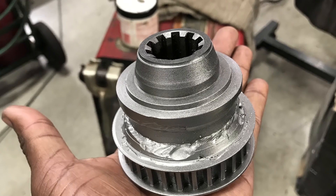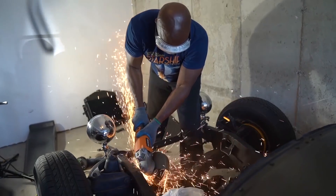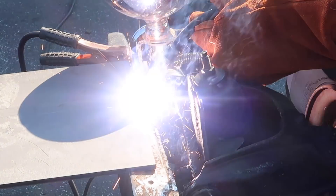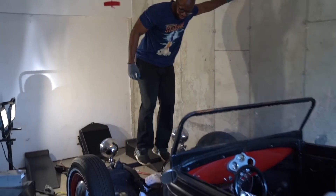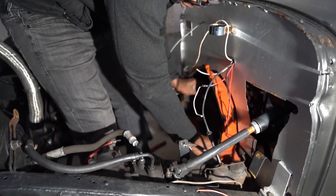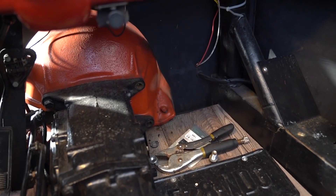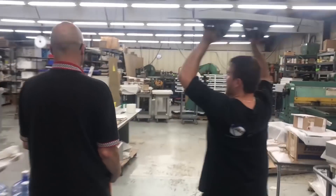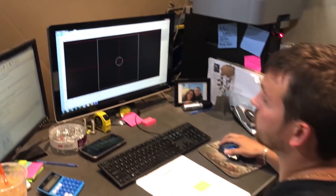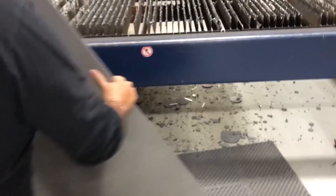Lee made one hell of a badass coupling — I'm going to have to look into getting a lathe and adding that to my 3,212-point wish list. In the next episode I'll be doing some more cutting, grinding, welding, and jumping on the rat rod, but let's get the second very important thing out of the way: a mounting plate. The mounting plate is what connects the actual motor housing to the transmission bell housing. In order to get a piece of steel large enough, I have to go to a machine shop — I'm heading to AJ at PMS Manufacturing.